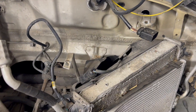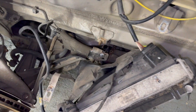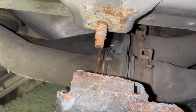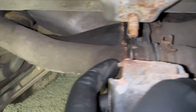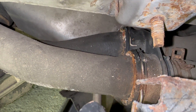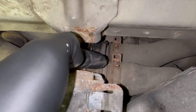Quick observation on the pipes — the new bracket has got the connections up to here, and these look just like quick-release circlips that lock around the rib section. However, these bits of the pipe look a little bit crusty. They're not leaking at this moment and I don't really want to upset them by removing them from this side and possibly damaging the seal, as then I think I'm in for a whole set of pipes. So I think I'm going to take the hose clamps off on this side instead.